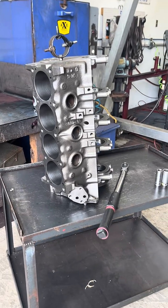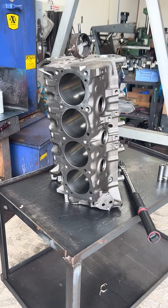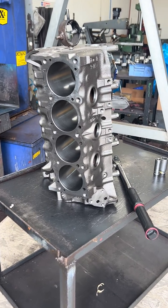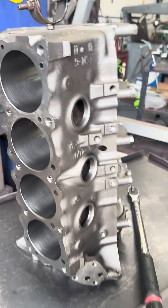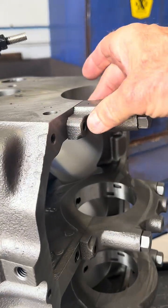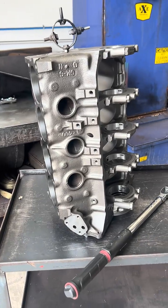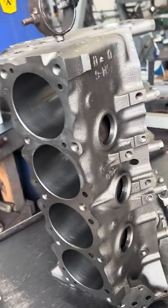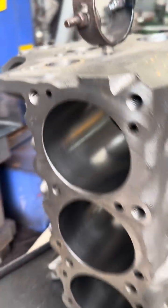I'd like to show you the process when I start to build some of my motors. Here I got one of my Pontiac blocks all ready to go. What I do is I'm going to set my dial indicator up and check the bores, make sure they're definitely perfect. My decks have been resurfaced, this has been line honed already, and I'm going to set that up and check it with a dial indicator also. I overlooked this whole block — it had a few bad holes, they were repaired.